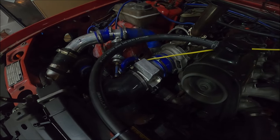It's time to test this pre-turbo throttle shenanigans. Now it's dry and daytime. Will it have any positive effect? Will it do clouds of oil smoke out the exhaust because of this so-called sucking in because of the vacuum on the compressor side? Which, again, is a fact, but not necessarily on these, I don't know. Let's go find out.